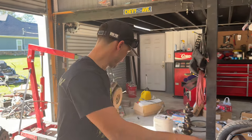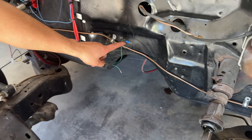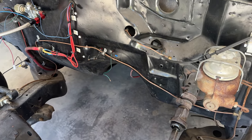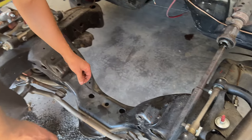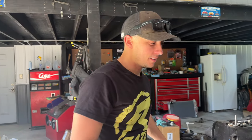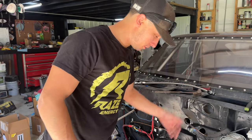While we've got the transmission out, look right here — what I thought at the time was a good idea with these brake lines. I ran it down there, just kind of bent it under there, ran it along there, and along the firewall. Dude, that looks absolutely terrible. It looked like you took a can of Coke or something to fit the corners. We're gonna completely redo that — come from the master cylinder down to the frame and along the back side of the frame. It's also a race car and the hood's gonna be off a lot, so people are going to see it. It's got to look good. The spindles and brake calipers are rusting. There's just a lot of stuff we could have done so much better. What better time than now when everything's absolutely apart? We gotta set standards and do it right.